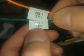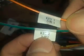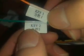If your car has a steering wheel button control function, you need to find out the steering wheel button control wire to connect the key 1 or key 2 steering wheel function control wire to your car. If you connect the aftermarket backup view camera, you need to connect this reverse car detection wire to the backup camera.